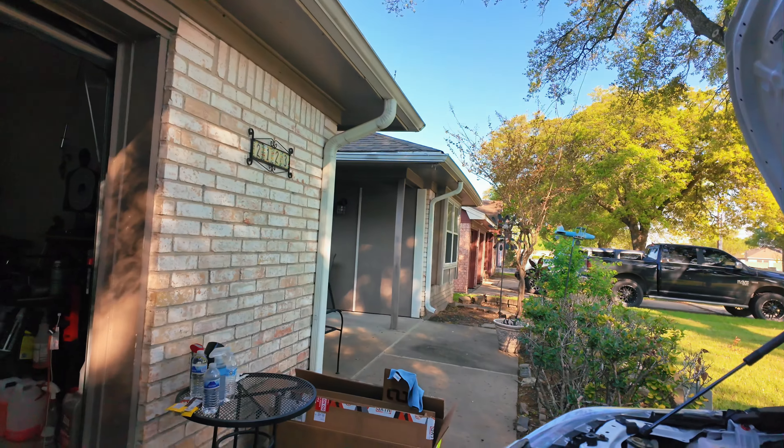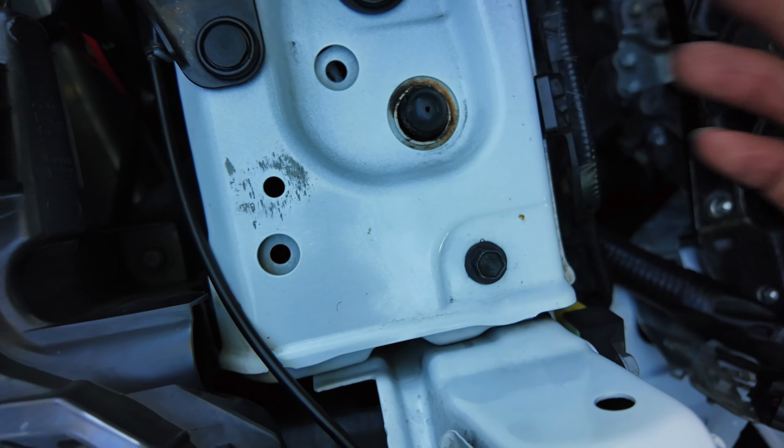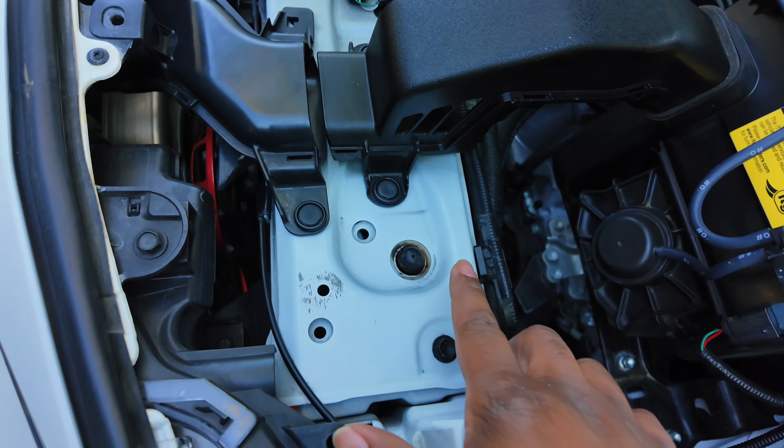Nothing about this is a solo mission. You could try it solo, but get yourself a jack, because if you only have your hands it's not going to happen. When you are mounting this back onto the car, these rubber pieces are where the radiator at the very top is guided into the radiator top mount — there's one on the other side too. If you're doing it by yourself, you'd probably throw it on, bolt it down, and not be happy when you get to the top and realize you played yourself.